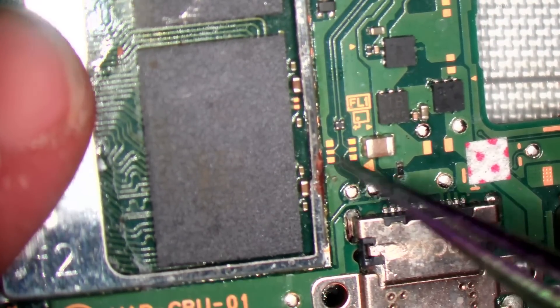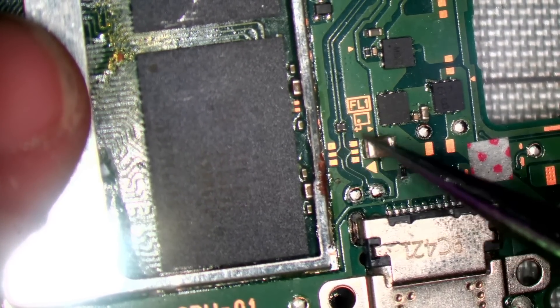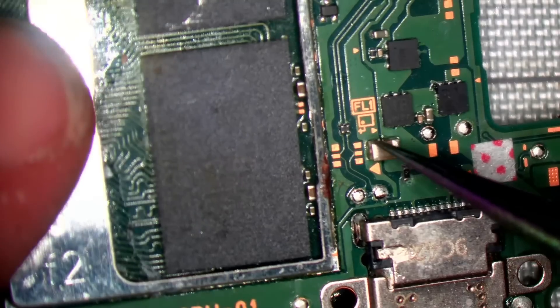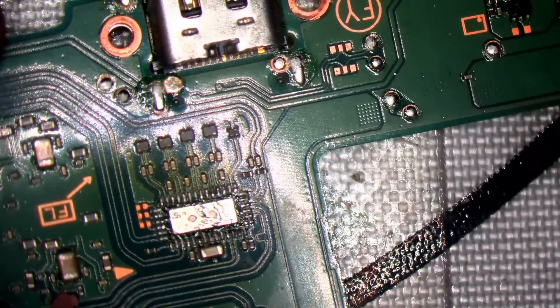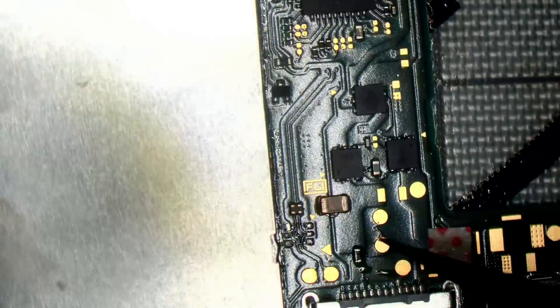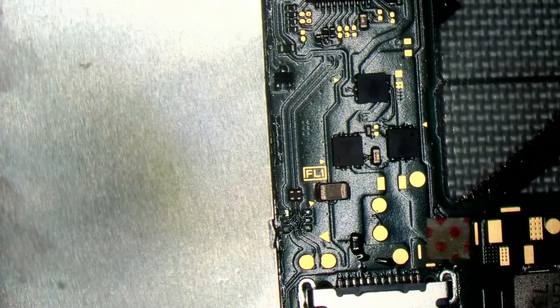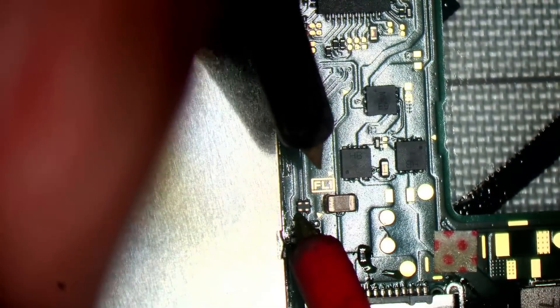So you've got one diode that goes up through there to the filter, and another diode - two in total, with grounds on either side. On the later revisions they removed them because they were causing no end of problems. Same with that one - two diodes removed in later revisions. Whenever I get a HAC-10 board in, I just remove them and don't put them back because it's one less thing that can fail. Chat question: do diode packs only fail when the charge port is damaged? Honestly, when I have seen failures, it is normally with a damaged charge port, but it's just one less thing to fail.